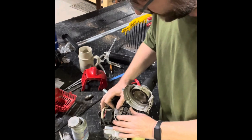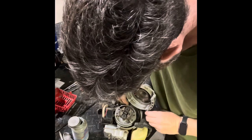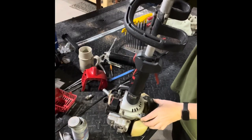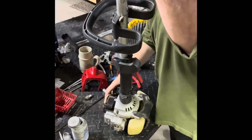But this one is perfect. There is a bearing on the other side of the crankshaft that's under the pull rope cover. You can shake the flywheel and see if it's ever been hitting the magneto. If that gap changes as the flywheel comes around, that's a good indication that your crankshaft bearing and seal is bad on the front side. But other than those two crankshaft bearings, that was a rare occurrence. Put this back together — the inspection looks good there.